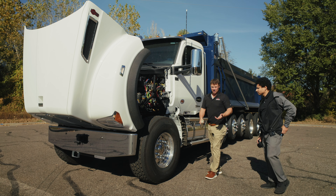When I drove, I liked to have a hammer to check the tires — a good pop on the tires. It should bounce right back at you. With relatively low tire pressure, it'll sound more hollow. You don't have to check your brakes every day, but it's a good thing to just give it a general look and see if there's any flaring on the belts or if there's anything leaking. We're just doing that general check before we hop in and get out on the road.